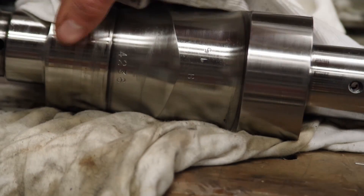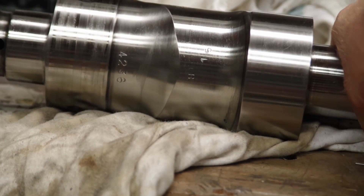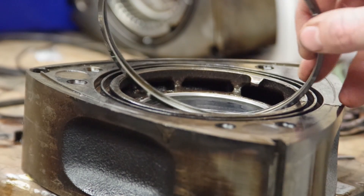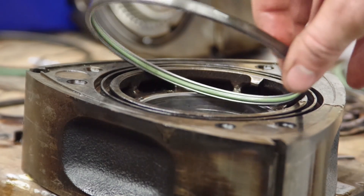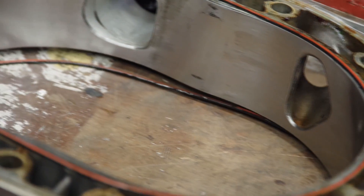The gear was heavily damaged. Having a look at the eccentric shaft, you can see there's a little bit of scoring on one of the faces, although you could probably polish that out. So that sums up the carnage - it's quite a spectacular failure. Now I want to take a quick look at what makes this engine a little bit different, so we'll look at what's actually been modified and the benefits of those modifications to get that little bit more power out of these things.